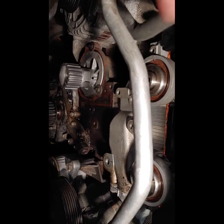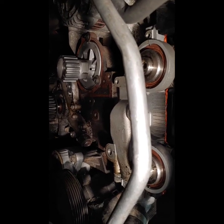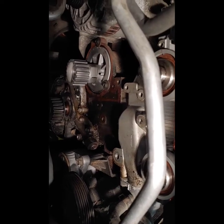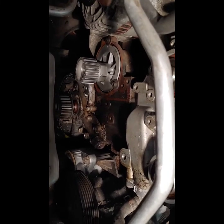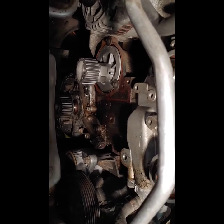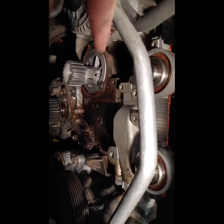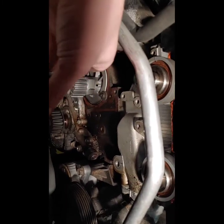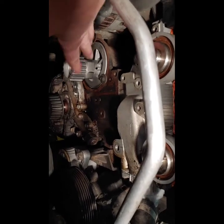You do not need to remove the water pump — just so everybody knows. If you're this far in and you haven't replaced your timing belt, pulleys, tensioner, and water pump, this would obviously be the time to do it. But if your water pump is still good, you do not have to remove it to get this shield off. Everyone else keeps saying you do — I did not. All I had to do was loosen three bolts a little, use the specialty tool to release tension off the timing belt, and I didn't lose one drop of coolant.